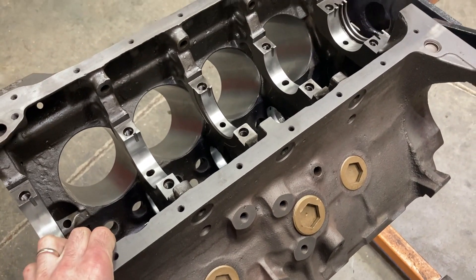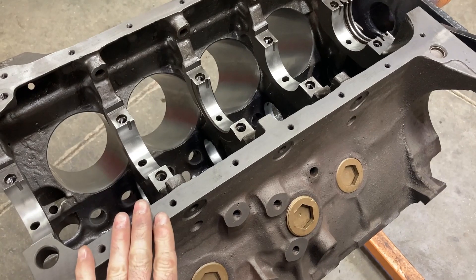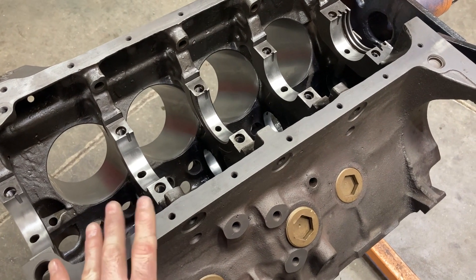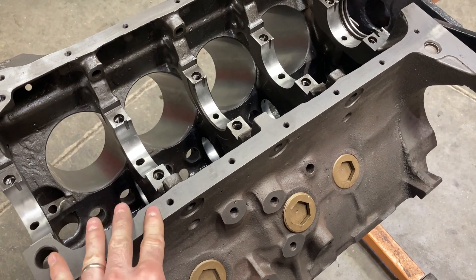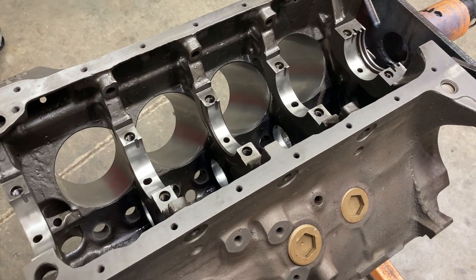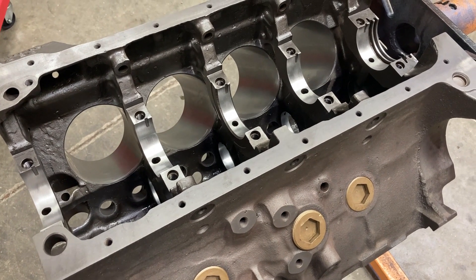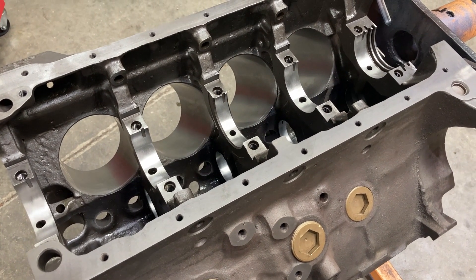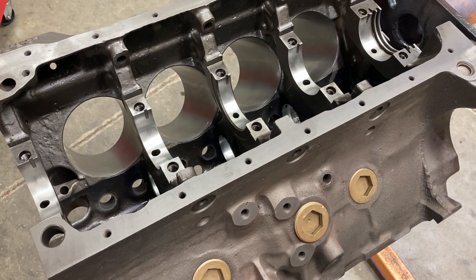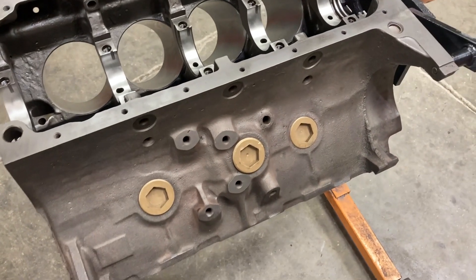On this build, we're going to use some Racetech forged pistons. It's going to be 465 cubic inches — 4.250 bore, 4.125 stroke — with a Scat 4340 steel crank. I've got some K1 6.800 rods for it, and a solid roller camshaft. With this customer, we're going to do about 12 to 1 compression, and he has the two four-barrel single plane intake that's also getting port-matched to the heads and ported inside the plenums. This is going to be a pretty stout little motor, so I'm looking forward to getting this one done and seeing what it does.